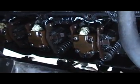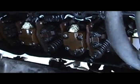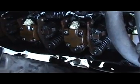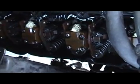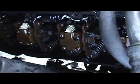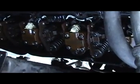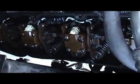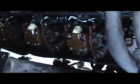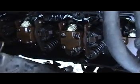Now, before you get to taking the valve covers off, let me give you a hint on a little trick. I take a digital thermometer, and when the truck's cold, I shoot the exhaust manifold and get a reading to see what the temperature is. Say it starts out at 62 degrees, then I'll fire the truck up. If you see some jumping up to 100 degrees real quick and one staying at 70, then you kind of have an idea where to start looking.